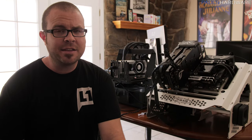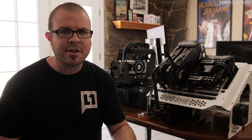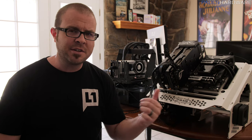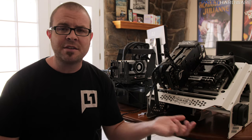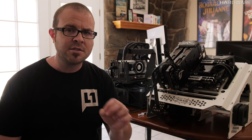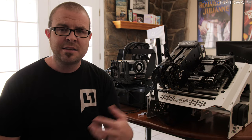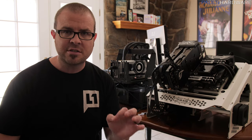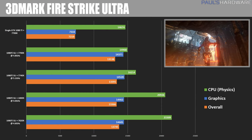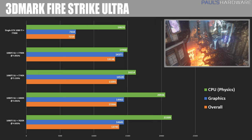All of those charts represent a lot of work, so I hope you looked at the numbers carefully. Looking at the synthetic benchmarks — like 3DMark — they might initially seem to indicate one CPU platform is doing better. However, those synthetics weigh raw CPU performance heavily and have physics-based tests where higher core count CPUs do well. If you look at the GPU scores on those tests, there's only about a 100-200 point difference between each of the four platforms using the same GPU configuration.